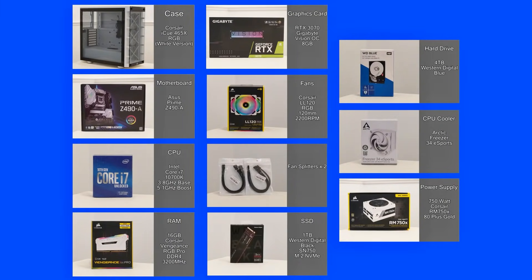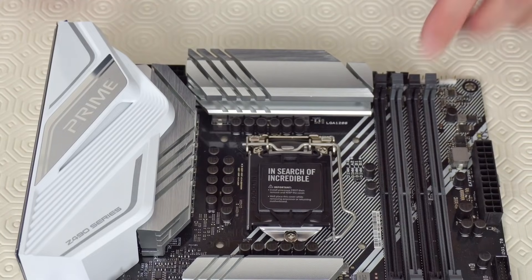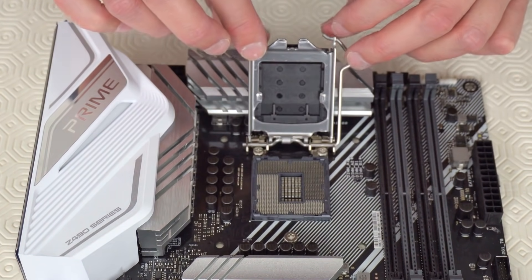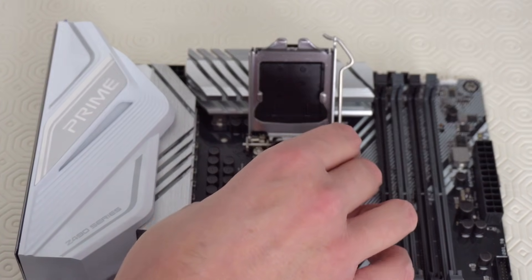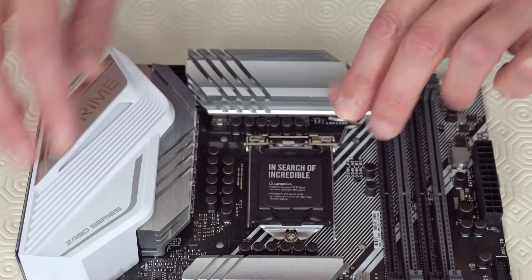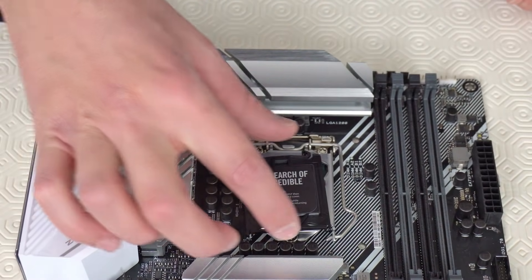So here's all the parts at a glance. I'll be showing you how to build this computer but I won't be going into such minute detail as I normally do, so this will be more like a quick guide for a change. So let's make a start by putting the processor into the motherboard. We're going to be installing the processor just here — lift up this arm and the lid, then line up the small triangle on the processor with the dot on the motherboard, put down the lid and the processor arm, and take off the plastic top.